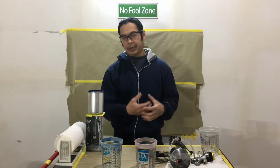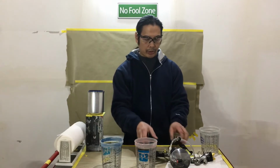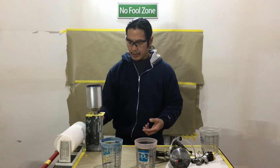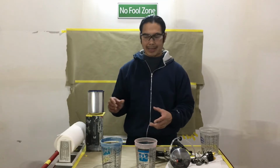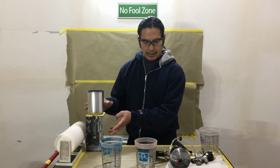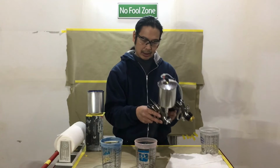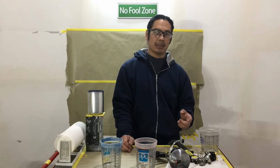And some clear coat is going to be real thick. It's so thick that you are trying to push it through a smaller size 0.8, and you're figuring out it's not working so well. So you need to step it up to a 1.0. A 1.3 is a pretty decent size, but you're still doing a lot of waste. It's had its day, and there are people going to use it, but this is where we're going now. This is the direction painters need to think about, because 0.8 really is an efficient needle and tip.